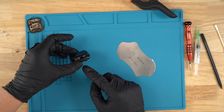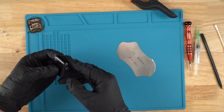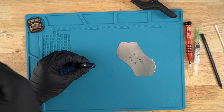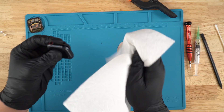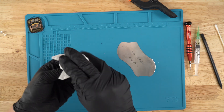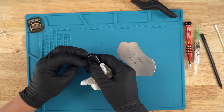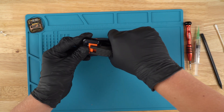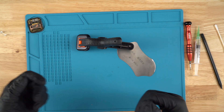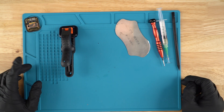Once you have placed all the glue where it's supposed to be, you're going to kind of align the screen and just push it down. Make sure it's sitting all good. You can grab a paper towel or something and just wipe all the extra glue residue off the unit just like this. Make sure it's as flush as possible — it's sitting pretty flush. Then we're just going to grab our clamp, or you could just use rubber bands, some way to keep pressure on the screen so the glue can heal and the screen stays on. And there we go — that is how you replace the screen with this toolkit.